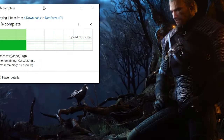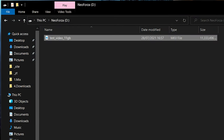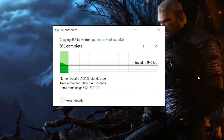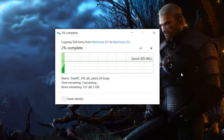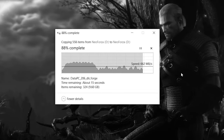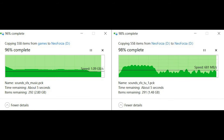Now let's tackle my favorite part: real-life transfer tests. First I'll copy a single 11 GB video file to the SSD to test burst speed, followed by a copy of the same file from the SSD onto itself. Then the same process is repeated with a large 85 GB installation folder from Assassin's Creed Valhalla. For the burst single file test everything is flawless and smooth. Only in the mixed 85 GB transfer copied onto itself did I witness a drop, but that's normal — the SLC cache has been exhausted and the TLC cells take over at their native speed.